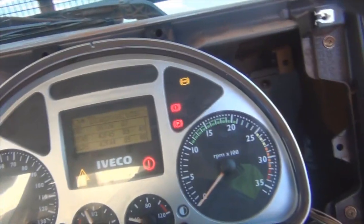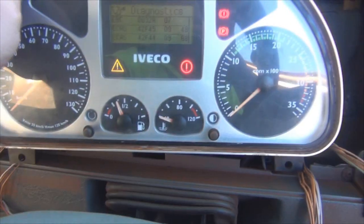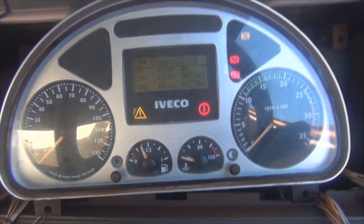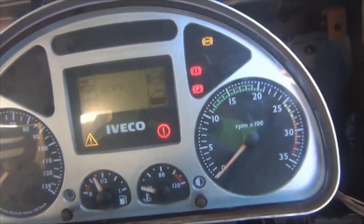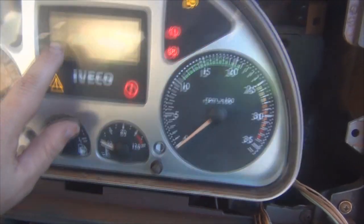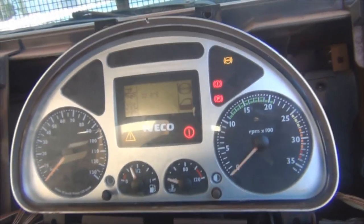I can't turn the lights on right now because I've got the lights moved, but when you turn the lights on, apparently these buttons are supposed to change the brightness. That's meant to be the trip meter, but that never appears because it's missing. The number of kilometers the truck's done are actually missing from the dashboard altogether. Even the trip times in the trip computer are all unrealistic — just strange things. That button there is supposed to bring out the odometer and trip meter, and that one's meant to be the brightness of the backlight. It doesn't seem to affect anything either.